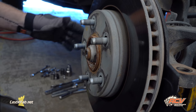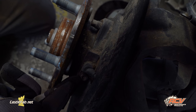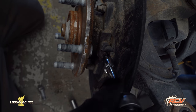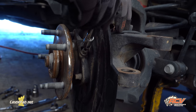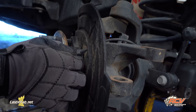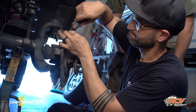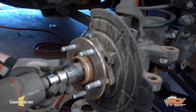Sometimes the rotor clips are a little tough, but now that those clips are off the rotor comes off with ease. Now that the rotor is off, you can see you have access to the ABS sensor and the five millimeter Allen that holds it on — you can now remove that. There's a little O-ring inside, so sometimes it's a little stuck; if you wiggle it back and forth you can loosen it. You can't fully remove the ABS line until the bearing and dust shields are free. Now we're going to remove the axle nut.